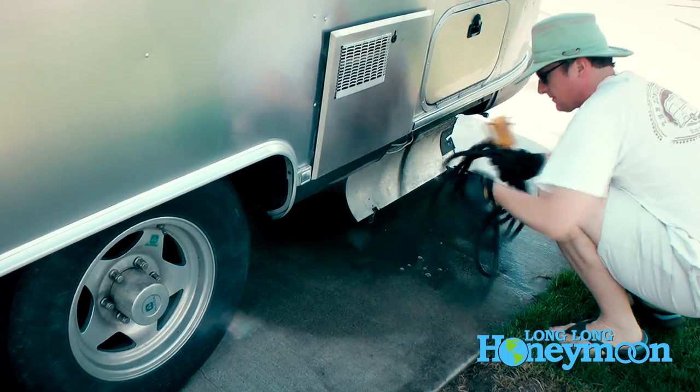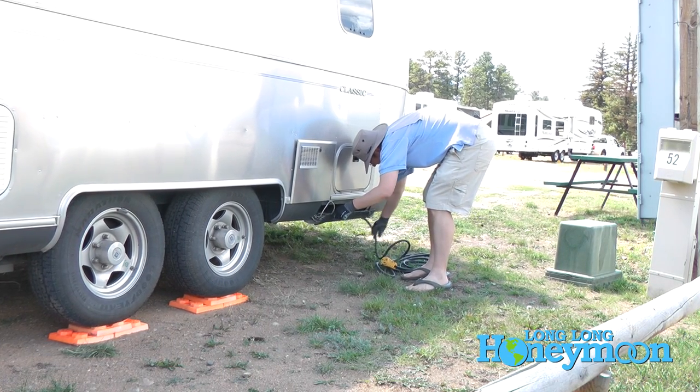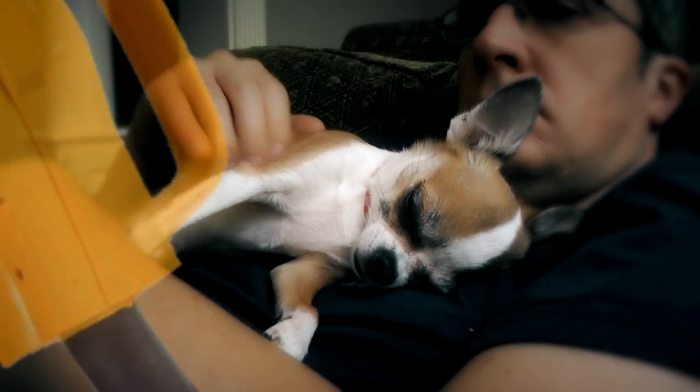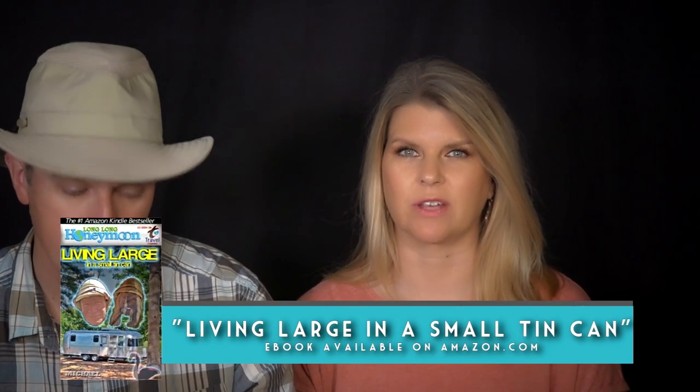For the power connection, it's pretty straightforward — just plug in your 30-amp power. However, we carry a 50-amp to 30-amp adapter called a 'dog bone' because of its shape. Every once in a while you'll go to a campground that only has 50-amp power, and if you have a 30-amp rig you'll need that adapter. There have been a few times over the years when we really needed it. RV resorts that cater to big motorhomes tend to have more 50-amp sites, so it's something to keep in mind. We'll put a link to a dog bone in the description.